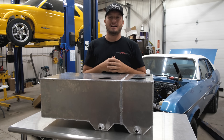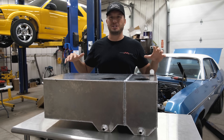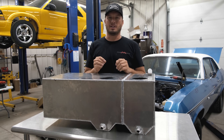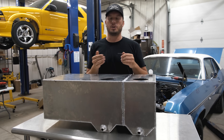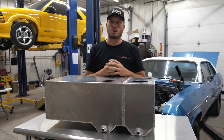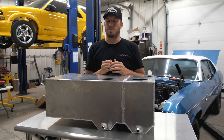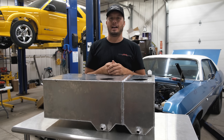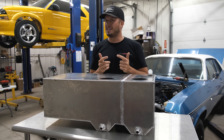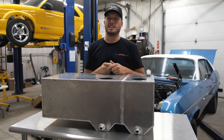That's it. I could go into all the science and do calculations, but I just wanted to let you know that the vent is something you definitely need to pay attention to. When in doubt, oversize it — it puts less stress on the return, less stress on the fuel pump, heats the fuel less, and overall makes your system work better. A good fuel system will make you a lot happier and break down a lot less on the road or on the track. Thanks for tuning in. If you have ideas for the next Tech Tip Tuesday, drop them in the comments below.